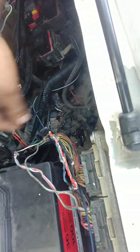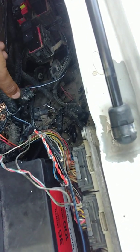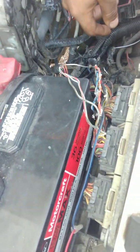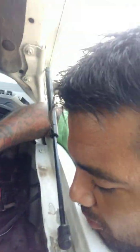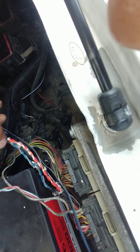Here's the harness that goes to the FICM. I opened it all up — it was nice and perfect, no damage or anything, just a perfect seal and cover. I pulled out the battery, put everything back together, opened them up and it started fine. Then I left it running, went inside to work on another truck, came back out and it was off. I started moving stuff and heard that ground-out sound again, so I started checking my grounds.